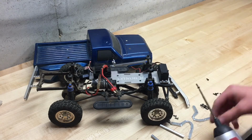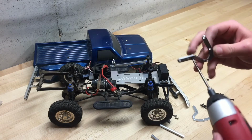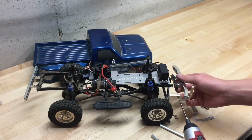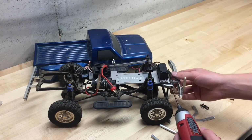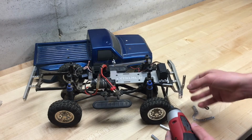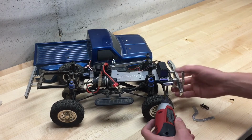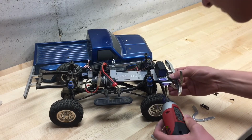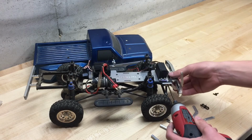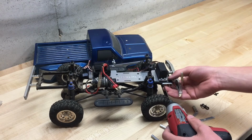and this can be the first screw you put in. You want to make sure you have them directionally correct, because they do have a notch to fit inside of that bumper, as well as to mount the tubes. Get that one started, then we can put the rest of them in, just starting them all loosely. Go ahead and tighten everything up on this side of the frame now.